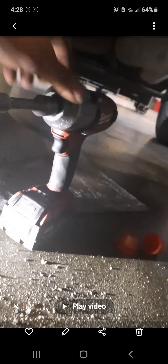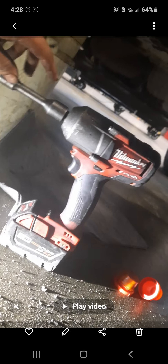As you can see, that 10-year-plus old Ingersoll Rand titanium, which weighs less and has an airline attached to it, could easily remove those driveline bolts. They're half-inch 12-point fine thread bolts, generally torqued to 125 pounds.